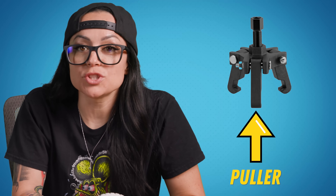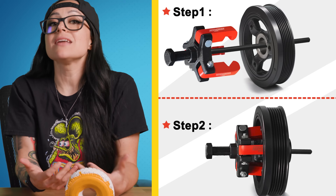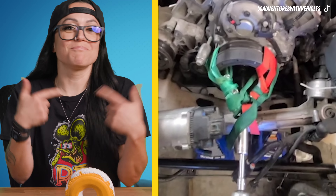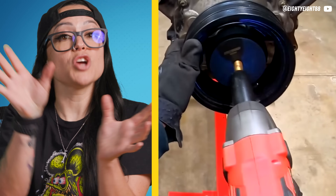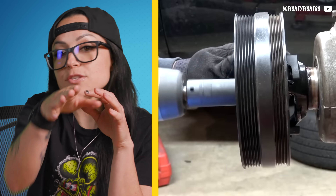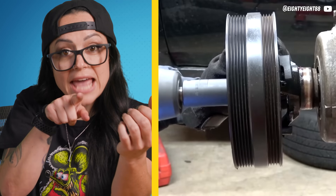Your dreams can come true. It looks like our buddy here has a puller, which you would need to pull off a harmonic balancer. There are a couple of different designs you can use. Looks like he has the kind that uses jaws that go around, but maybe he doesn't have the correct jaws because this is a larger puller. So instead, he's got some ratchet straps bound many times to the puller. For those who've never used a puller before, it has a piece with a threaded hole down the middle. You have jaws attached that hold on to whatever you're pulling off — in this case, a harmonic balancer — and a long bolt down the center that he's using an impact to tighten. As he's tightening, that bolt extends toward the engine side, and those jaws pull that harmonic balancer off.